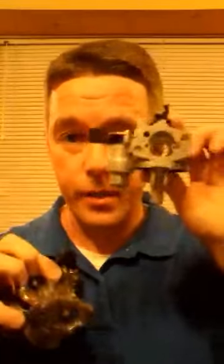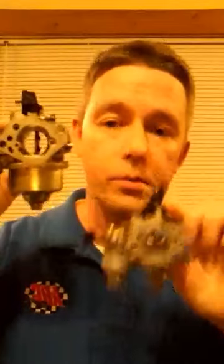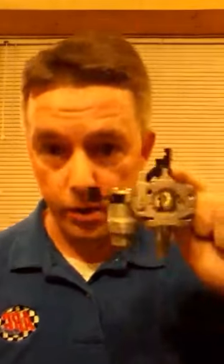This is a 615 Venturi. This is a 390 that I've worked. This one's bored out to 900. That's like I tell people, when they call up and want to order the biggest cam we got and still use a stock carburetor, I tell them that's like you working out your legs and doing squats and lifts and then trying to run a marathon breathing through a straw. You're not going to get the air intake you need to truly modify the engine. So to me, carburation is the first place I look when going to a modified.